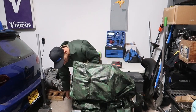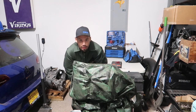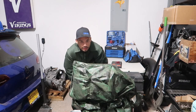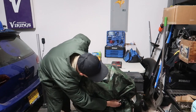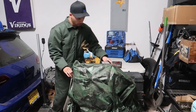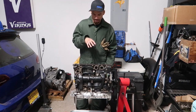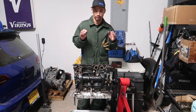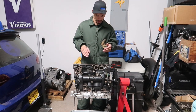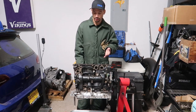Today we're gonna try and get the pistons out. I have the book open - we gotta take the balance shafts out first, which doesn't seem too complicated. From there we can take the pistons out; we might have to take off this upper oil pan. I want this thing broken down all the way. Once this stuff's out tonight I'm gonna hit up my buddy and discuss what he thinks, then take the boxes to the machine shop within the next two weeks. Hopefully that head's good and I don't have to replace the valves.